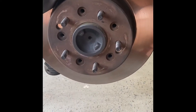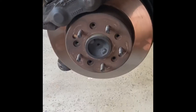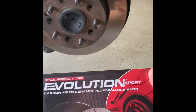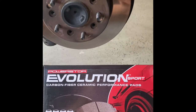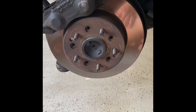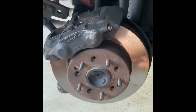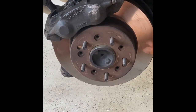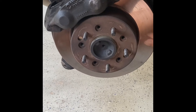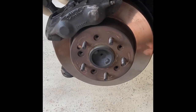If the rivets are already drilled out, then we just need to remove that and this rotor will pull right off — nice and simple. I plan on installing drilled and slotted rotors, and I've got Power Stop Evolution carbon fiber ceramic performance pads. I do not recommend the book-recommended organic pads as they are noisy. I've got the AC Delco organic pads on here right now and they squeal all the time. I've done everything correct — grease between the vibration absorbers, etc. They are noisy pads, so just do yourself a favor and go with some ceramics.